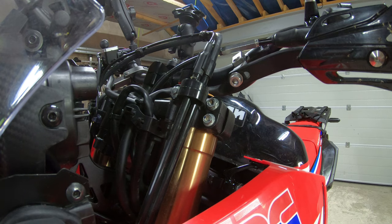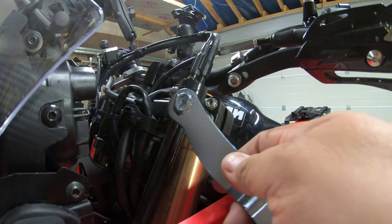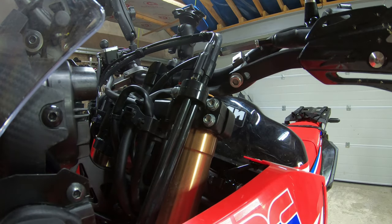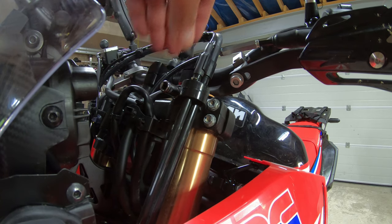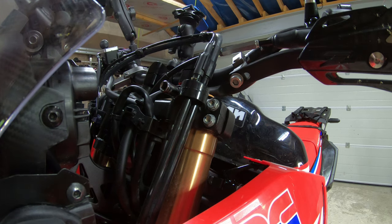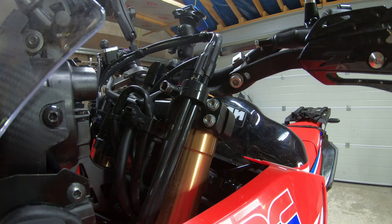I carry an 8mm socket which I can use with my other wrench. The guys at Rally Raid have a CRF300L, so it may be different on the 300L versus the Rally. For the two pinch bolts on the top of the left-hand fork, even though the 10mm wrench will fit onto those, you'd probably get the lower one off, but you definitely won't get the second one because of the plastic guide for the front brake lines. To get that off, unfortunately that bolt is an 8mm, not a 10mm. So even with the trail wrench, you also need an 8mm wrench — I use that extra socket with the same handle and drive to get that off and access those pinch bolts. It's only a minor thing, might not even be a problem on the L, but worth knowing that if you end up with slightly bent forks on the trail, you'll need either an 8mm spanner or socket to remove the brake line guide before you can loosen the top fork pinch bolt to straighten things up.